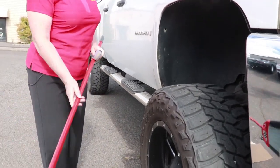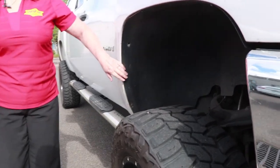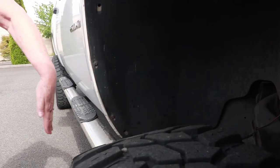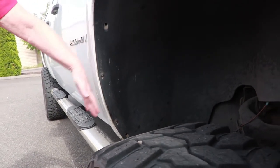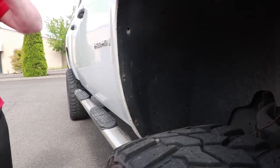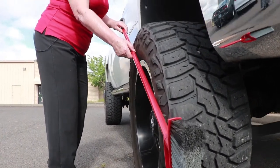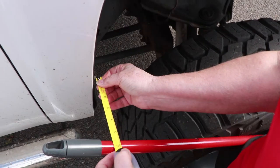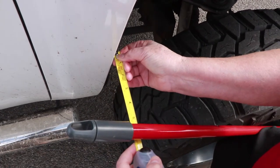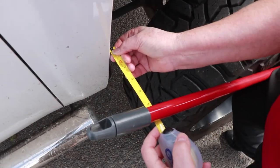To get your measurements, first you need to find the factory hole in your truck. To do this, you're going to want to write us and get install directions for your specific truck. Then you're going to find the factory hole that is the furthest outside of the fender well — being as close as you can to where you're measuring eliminates error. In this case we're going to measure from this factory hole here. We're going to put our broomstick across the tire, have it pointing up toward that factory hole, lean against that straight edge, and measure from the center of that factory hole to the inside edge of your broomstick. This one measures five and a half inches from the factory hole to the inside edge of the broomstick.